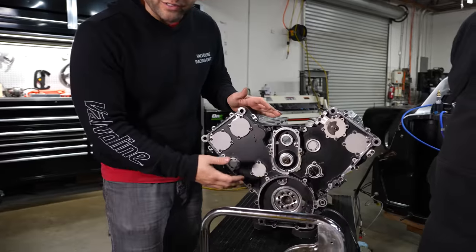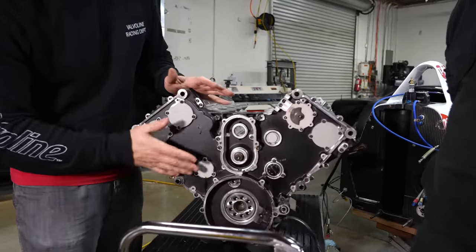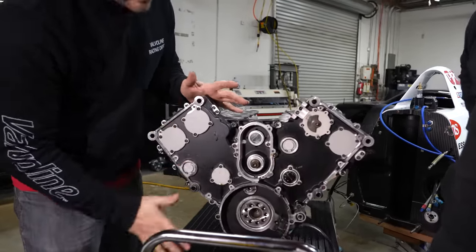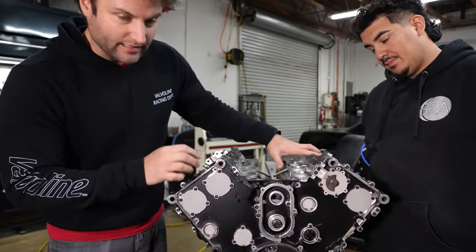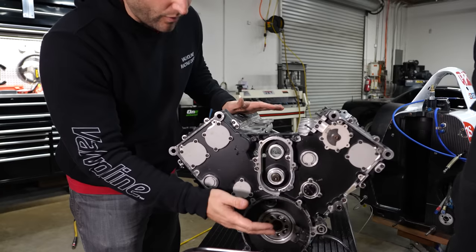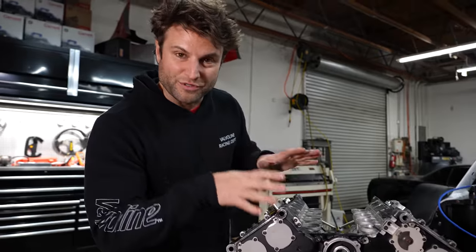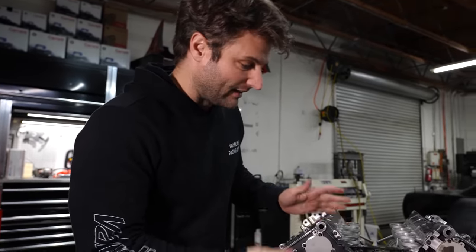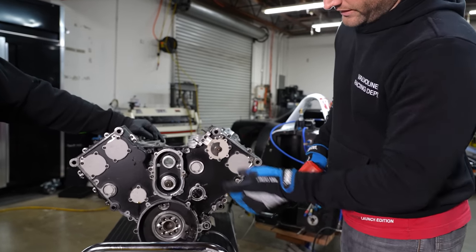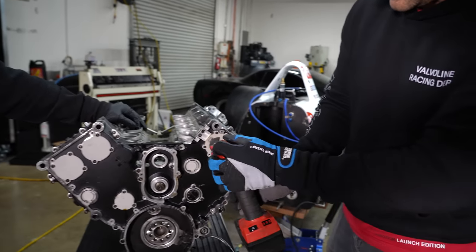It is finally time to begin cutting down to the core of the block. We're going to take this off — and just from pictures I've seen, it's going to look insane here. Our plan of attack is to see the insanity inside, take off the tops of the heads, then gently spin the motor after we've verified everything's okay, and watch all the valves move — get a nice idea of firing order and all of those things. We've got a lot of reasons other than just making cool content. The very first thing that makes sense is to take off the camshaft synchronizing thing.